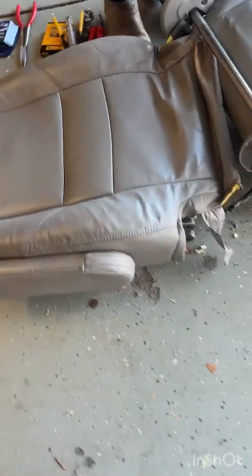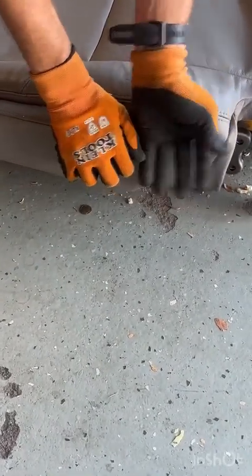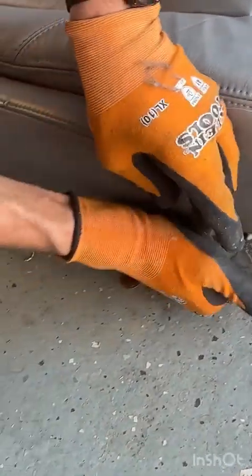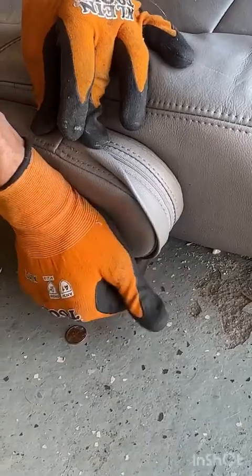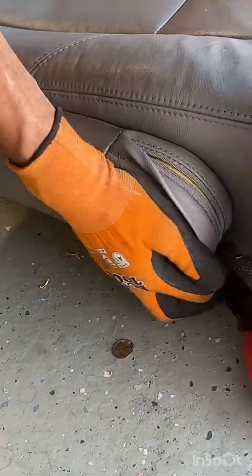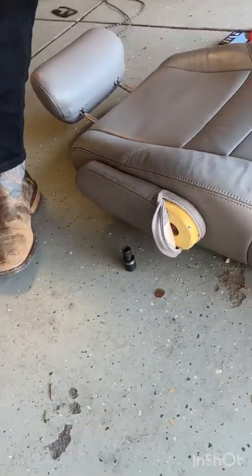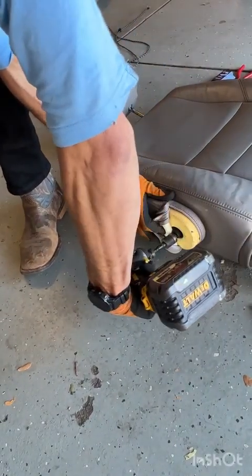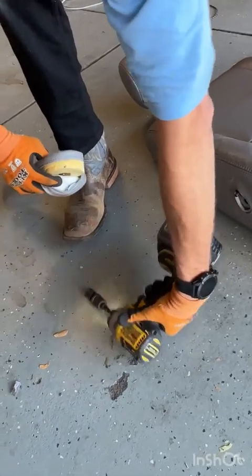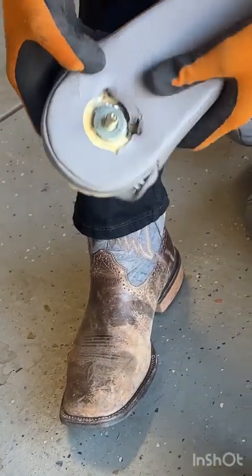So now, we're gonna take off the armrest by folding the entire little armrest flap over all the way to the top. Then take your pliers, just to make it easier, run right along the contour, open it up, and we've got a number 14, I believe, bolt. Now, there is a little plastic collar on here, a little washer that slides all the way down in there that holds it tight and gives it a little tension. Make sure that doesn't fall off. Set that aside with the rest of your parts and keep peeling.